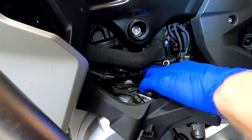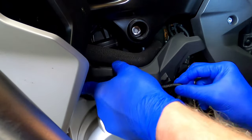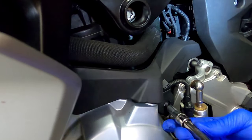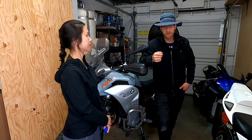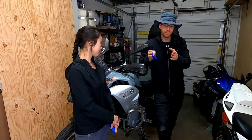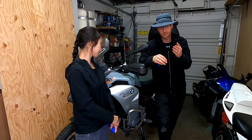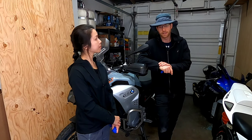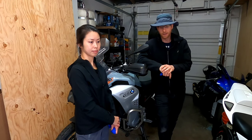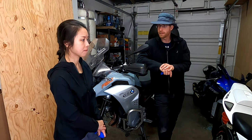That's pretty snug. Just test ride it — I think it's your actual clutch. We took off the panel, we loosened the adjustment to the point where the cable was almost falling out, and then snugged it back up just to the point where it's not going to fall out. So theoretically, that little clutch lever should be all the way back. My hope was that maybe it had tightened itself up and was always sort of quasi-engaging the clutch. I don't feel like I got very much out of it, so the only thing left to do right now is a test drive.